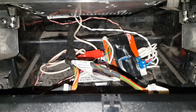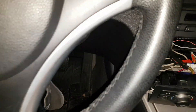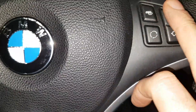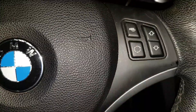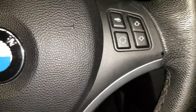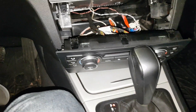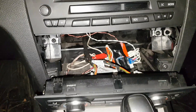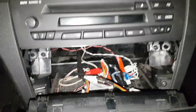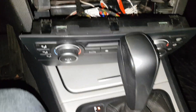I emulated the button presses in software on the Arduino, so it works pretty well. It's pretty sensitive, so if you want to skip a track you have to be very quick. I inserted a slight delay but couldn't exaggerate it, otherwise it would start interfering with the longer press functions. If you just click quickly it'll go to the next song; click again and it'll go to the previous song. I can't show you right now since I only have this phone, but I will upload the code to some site or a BMW forum.